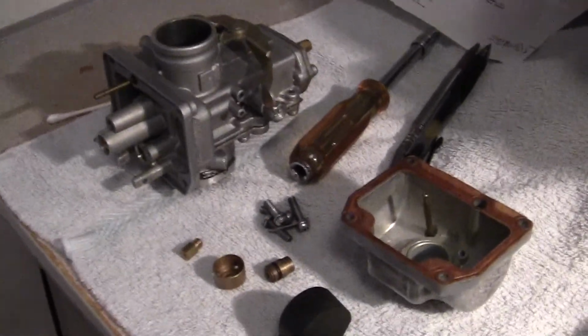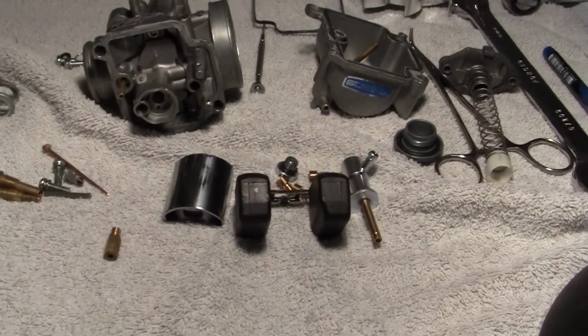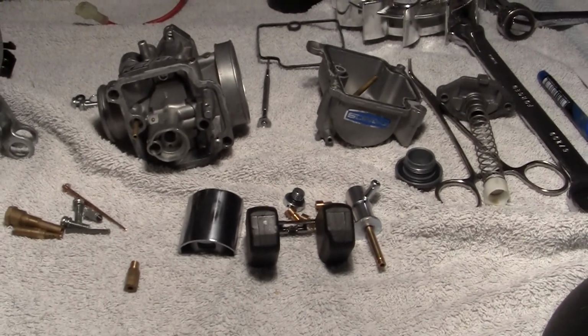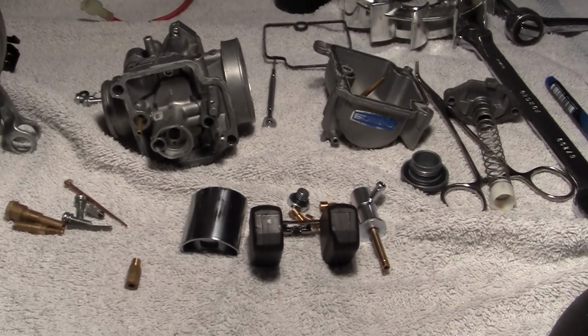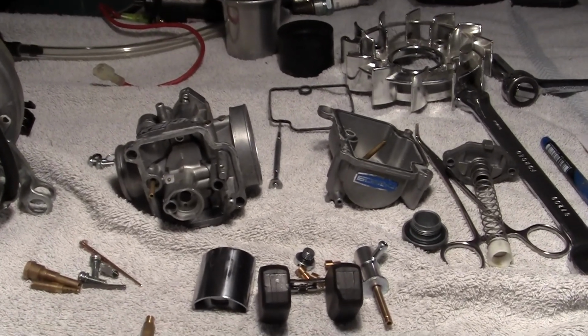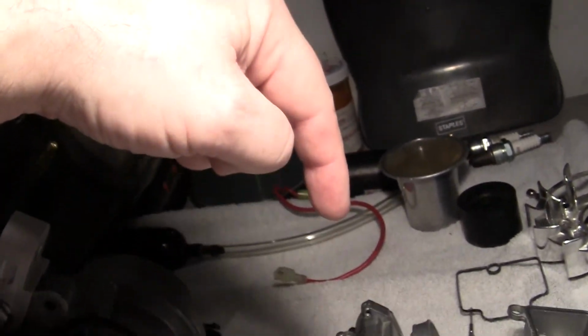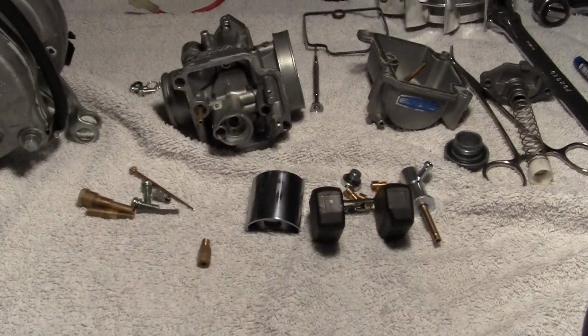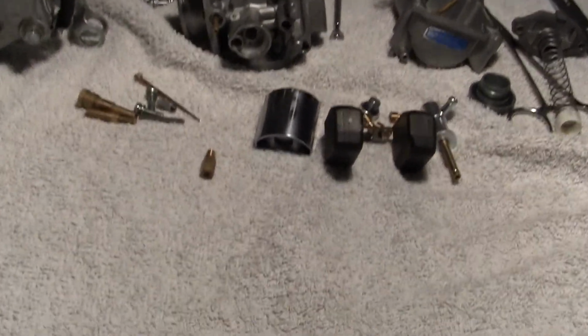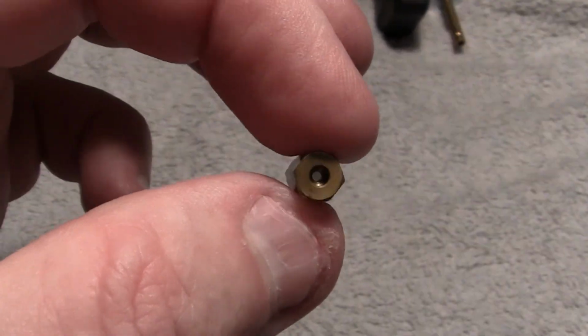along with this. But if you take the time and tear your carburetors down and take a look at them, you can't really hurt them. You want to keep them clean. You want to make sure that there's no leaks, no little bits of paint or detritus or whatever. And you want to use a little tiny fuel filter somewhere between your carburetor right here and a fuel line which goes over here and into your fuel tank. They're a little $2 item that can save you a lot of problems, because if you get something that clogs that up, you're going to have to go in